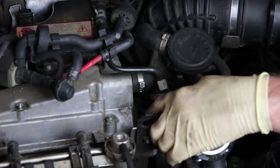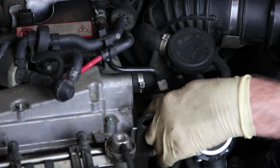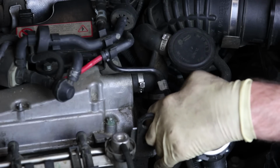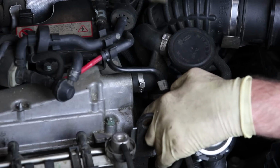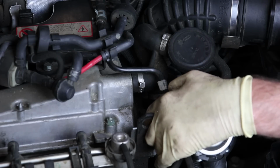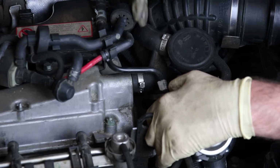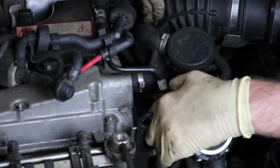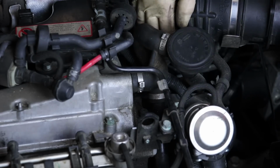So I actually was talking about a chain tensioner. It looks like this car, I didn't realize, does not have an actual chain tensioner, which just means it doesn't have variable valve timing. I believe it still uses the exact same gasket and seal. It's like a half moon, but it just doesn't have the electronic adjuster that actually controls the variable valve timing between the cams, which means this car would not have variable valve timing, and it's just manual. So I actually did not suspect that on this vehicle.